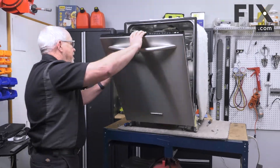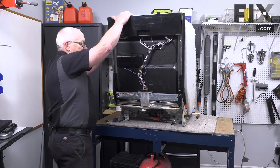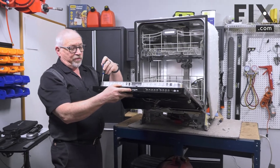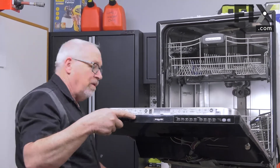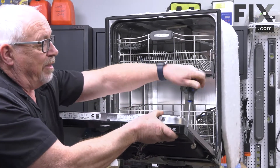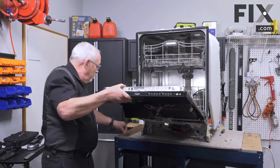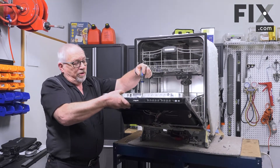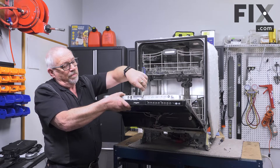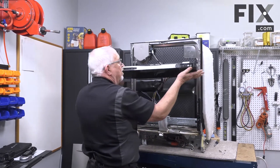I'm just going to raise the door up a bit, take control of that front panel, and lift it off. Depending on your model you may need to lower the console as well — it's just a matter of removing the last few screws that hold it. On some models you may have no choice but to take all the screws out to get at the part you want to change. Hold on to the console panel and the inner door liner so it can't fall on the floor. With all the screws removed you can let the door close and lower it down out of the way.